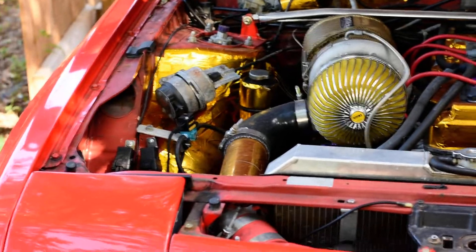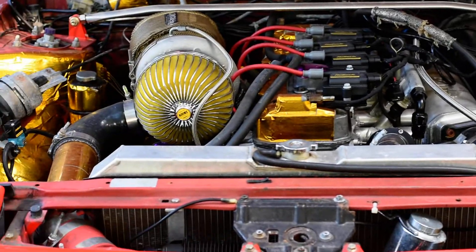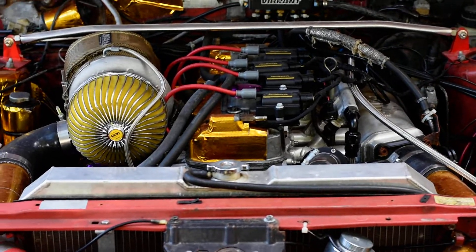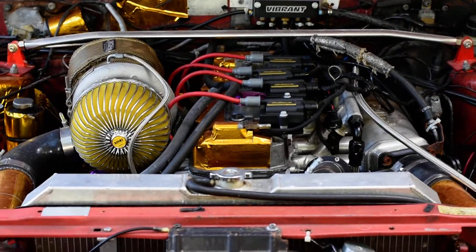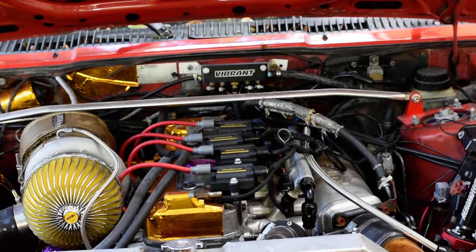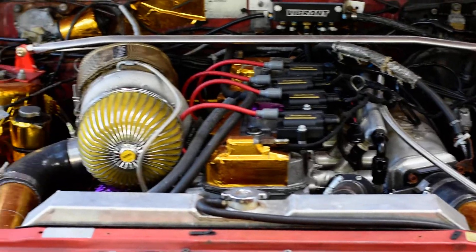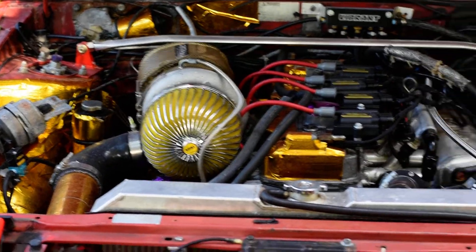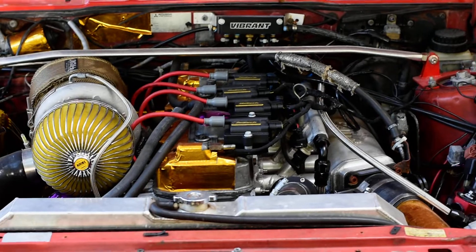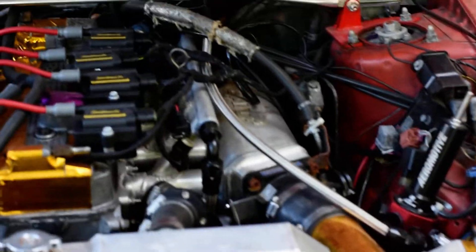For a lot of you people who don't know what this car is — it came with 188 horses from the factory, with a 7.0 to 1 compression, with 9.5 pounds of boost on 88/89s. The earlier models ran 7.5 pounds of boost. Right now my Haltech is set in closed loop on 18.5 pounds on a stock block, running 1600 cc injectors.